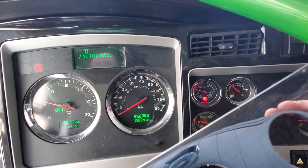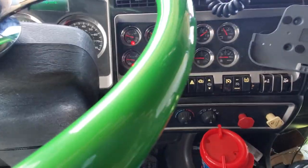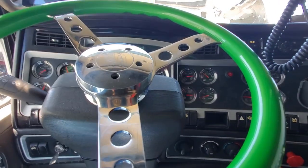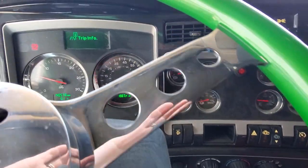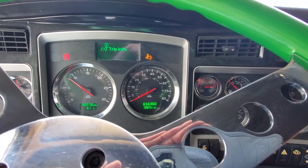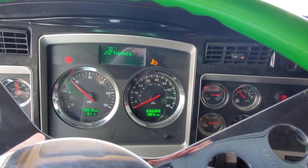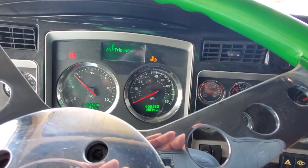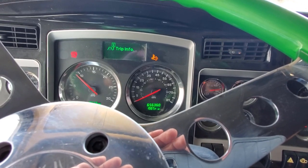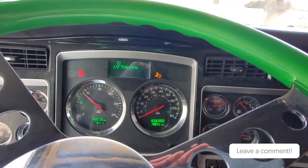I'll go ahead and let the air pressure build up. Okay, I just got my air pressure up to where it popped off. I'll push this button down and hold it for a few seconds — and there it goes. The truck idles up by itself and that light comes on so you know it's doing a regen. It usually takes 45 minutes to an hour to complete. While it's doing that I'm going to go put those two skirting panels back on and let it do its thing. I hope that helps you out. If you've ever got any questions, feel free to message us. Please like the videos and subscribe — appreciate you watching, thanks.